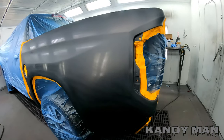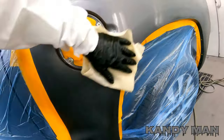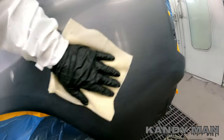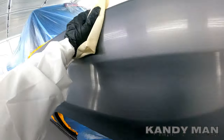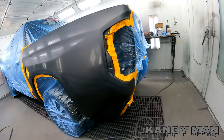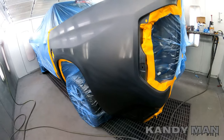It's all flashed off and I'm going to go ahead and tack it. Most of this panel is clear coat so I don't have to worry about my tack rag sticking in the base coat. We'll be clearing this one with the DV1. It does pay to communicate in the body shop — everybody makes more money and you can do a better job faster with less materials. This is one more job moving through the booth today. Let's go ahead and clear it with the DV1.